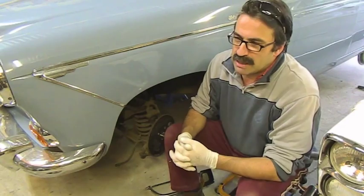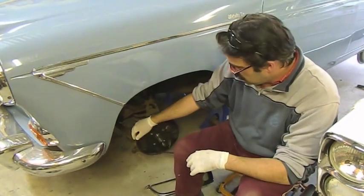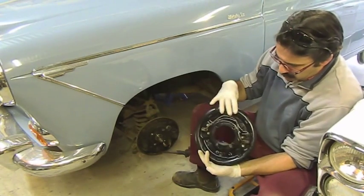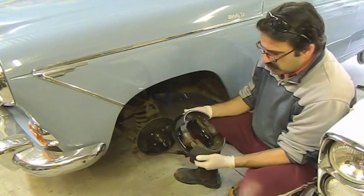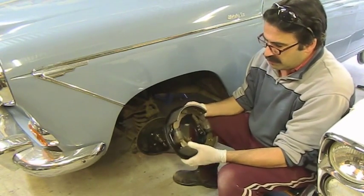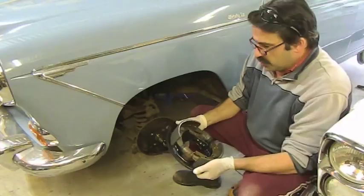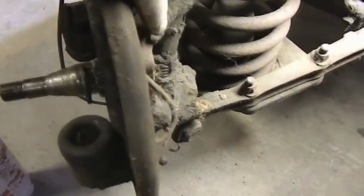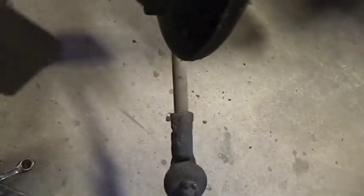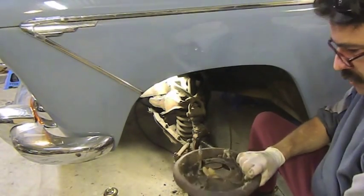When I was little, my favourite meal was roast lamb and I used to eat all my veggies first and save the best part till last. I still do that as an adult. But on cars I always start with stuff I like doing and leave this stuff till last. Working on front ends is just a shit job. I like to rebuild them on the bench so I know which way is the top and can get these lines around the right way and put them on as a unit. It's much easier working a couple of 5/16 bolts and nuts through here, clamping them in a vise and stretching the shoes over. These are the rebuilt cylinders and rebonded shoes. It's actually quite scary looking here - it's so neglected. There's build-ups of muck everywhere. Just to get to bolts and nuts you sort of have to scrape it off. Absolutely neglected.